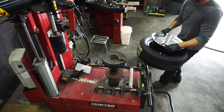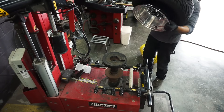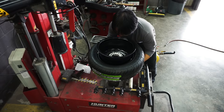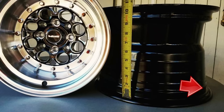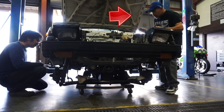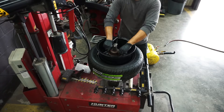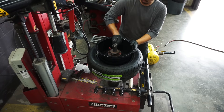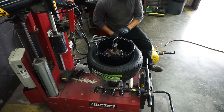This is the first time I've done a tire stretch this extreme, so everything I'm about to do is kind of experimental. Why upside down, you might ask? If you look at a rim — at least this one — you'll notice the taper leading to the bead seat is a lot longer on the backside than the front. Tom's theory: having the front bead seated initially and blasting air from the rear as the sidewall expands, the opening for which air can escape gradually lessens because of the longer taper, versus the short tapered side which will be fully open until the very last inch.